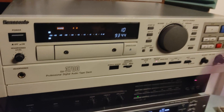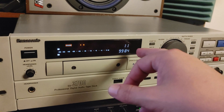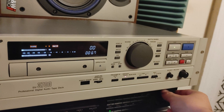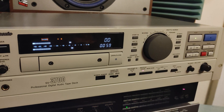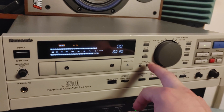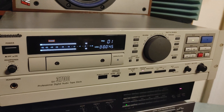Press mode, reset, and pause to access the hidden menu and check the error rate. On some models you can also check the hours on the head — on this model it's a mechanical counter at the back. I didn't check it, because if the error rate is low and the sound is good, that's already good enough for me. If the error rate goes above a certain level, you'll see a cleaning warning on the display. I recommend buying a cleaning tape, as it will help reduce the error level. Now I'll exit that special menu — this is the normal menu showing absolute time.